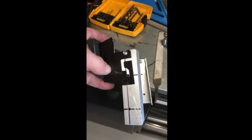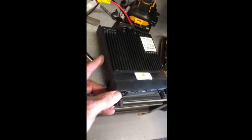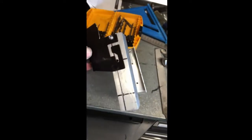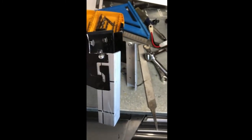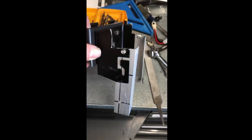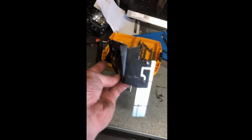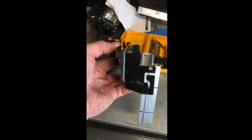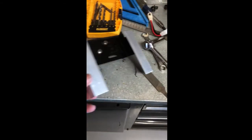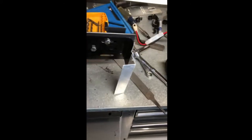I'm wrapping up the installation of the ham radio. The bracket is supposed to mount here, but that pushes the top way too high — I wouldn't be able to close my center console glove box. So I added aluminum angle irons down the side so I could slide the piece down until it comes up pretty much flush to the inside of the center glove box. This is the plastic piece from the factory glove box, this is the mount, and these are the additional angle irons. I need to find the bolts and I'm going to paint these so they don't stand out.